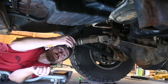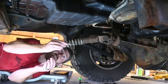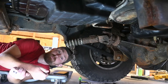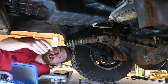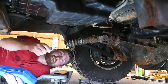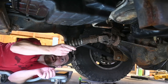I made a mistake trying to get this out. These are T40 Torx bolts all around, and I've been using a regular T40. I got three of them out and one started to strip on me. I stopped and realized that the body of the socket is hitting the universal joint, so you can't get it to sit straight. What you need for this job is a longer T40 with a thinner shaft that comes out past the universal. I went to four or five different stores looking for these and ended up having to order them on Amazon — apparently nobody stocks this.